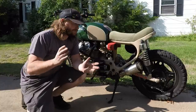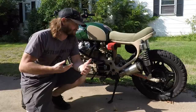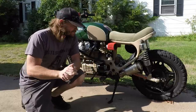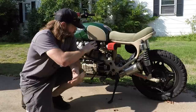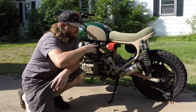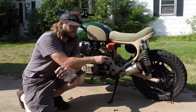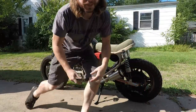When I did this bike I was a lesser skilled, lesser experienced person. I actually don't know what jets are in it at this point — I've long since forgot. I know the carbs are going to be kind of out of tune. This thing probably has a familiar cough that many of you are experiencing on your bikes. The overall setup is a set of Uni PK92 filters with a pre-filter, and I made a 2-in-1 exhaust with an inch-and-a-half primary that exits through a Supertrap, which sounds really good. Let's fire it up so you guys can hear the cough.